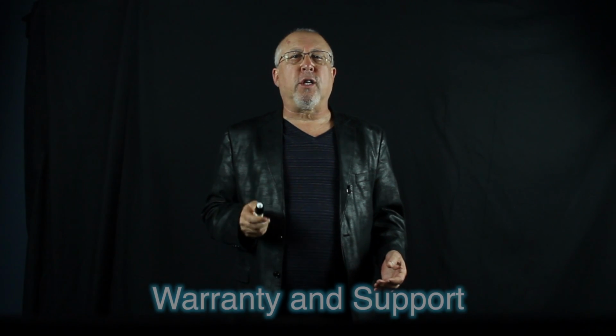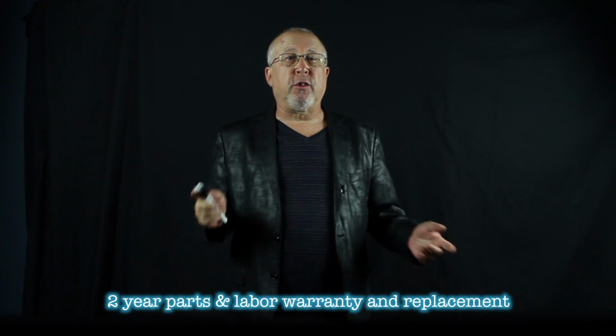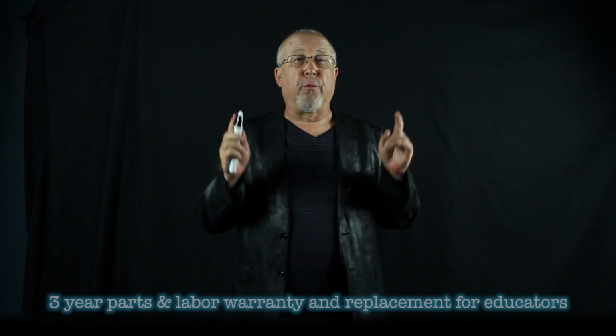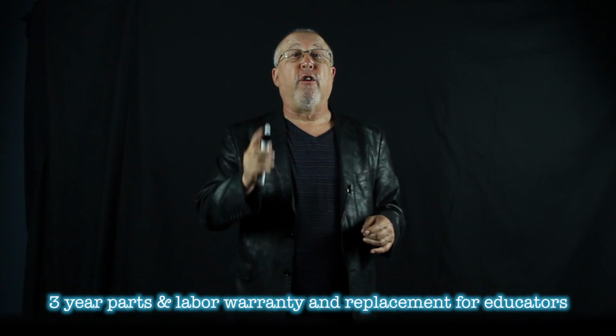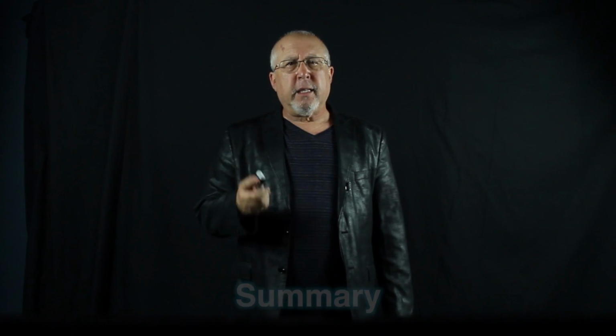Finally, let's talk cost of operation, warranty, and support. Epson provides 2 years parts and labor and a 2-year replacement program. But for schools, the Brighter Futures program provides a 3rd year of both warranty and replacement program. LCD projectors like this Epson are more efficient than DLP projectors, so they draw less electricity for the same on-screen brightness. And finally, Epson's lamps for this projector are rated an awesome 6,000 hours in eco mode, 4,000 hours at full power. Let's sum it up.